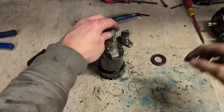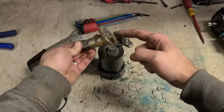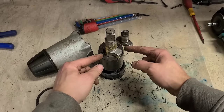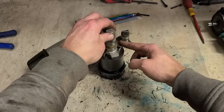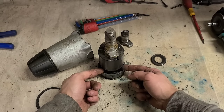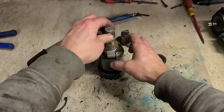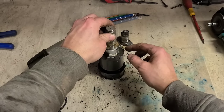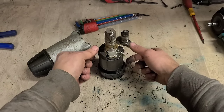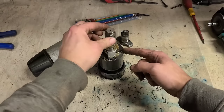And it's nice, these here anvils as well, and the Makitas. See the hole here? That's actually connected to the center bore. So what that means is, whenever this is running, what she's doing, this big weighted hammer, she spins around and she jams up on the anvil. What happens then, there's a big massive spring inside of here. There's a big gear system, so it's actually torqued around. This will overcome the actual anvil, and this will press down the spring and she'll ride up over the top. And whenever she gets to the other side, this weight will spring back up, this hammer, because this is what it is, she's a big lump of steel hammer, and she will swing around and slap that hard, and that's your actual impact. That's what's torquing off your nuts.